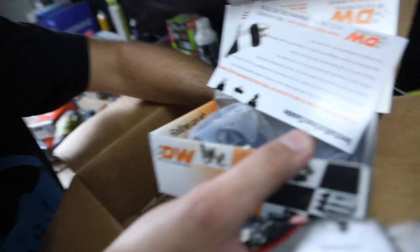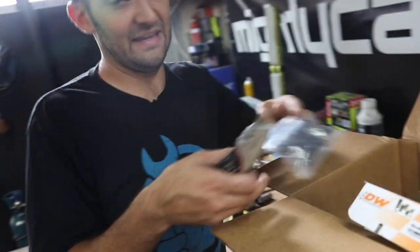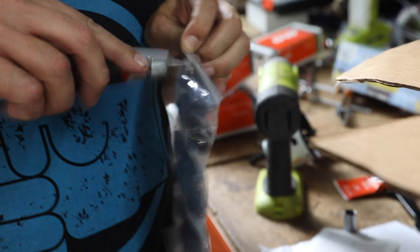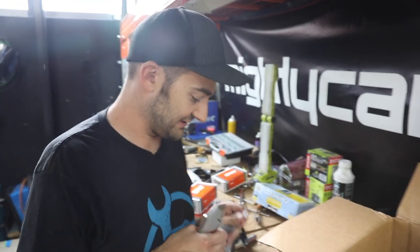Martin, what size are these injectors, mate? So good. I think these are 1200s. 1200s. Awesome. So these are going to be our injectors. They're going to flow heaps, heaps for what we're doing, because it's going to be on petrol when it's driving around the streets, and then if we feel like putting ethanol in it, we can. Yep. We're going to put a flex sensor in it. Haltech's going to know when it's got ethanol in it.